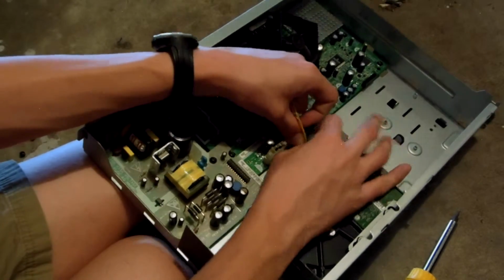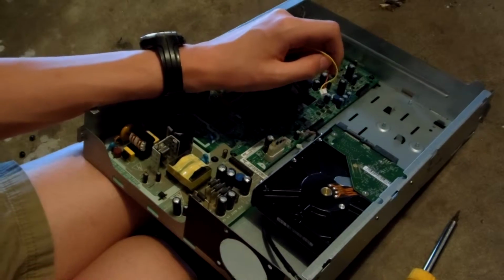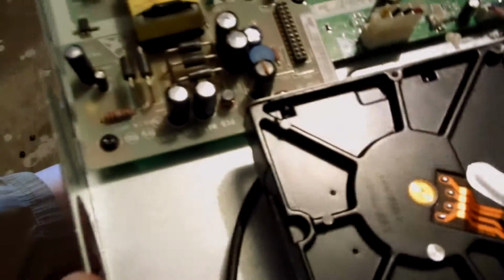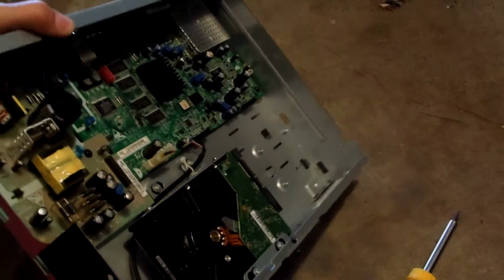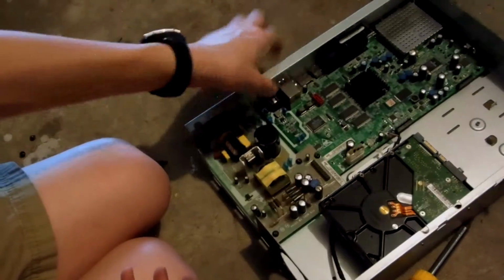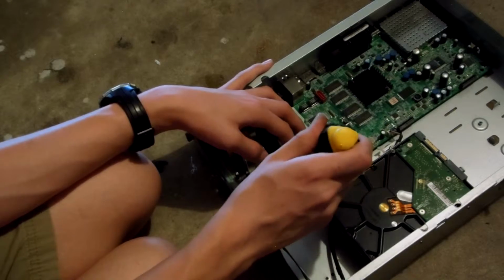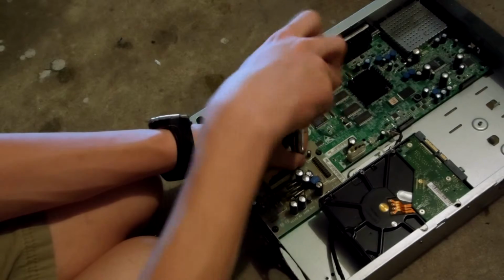And I can tell this thing is not tested, and it probably wouldn't work because on these boards you can see a lot of those capacitors which help in power are bloated, and some of them have exploded and leaked their electrolyte. So this board would probably have a very low life if you bought it. I got this one from the thrift shop for like 95 cents, but it was half off, so whenever I scrap boards, I can get a profit on them.